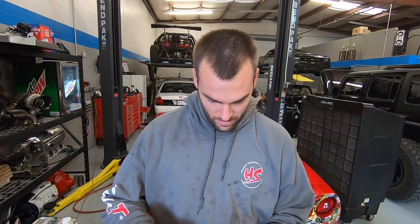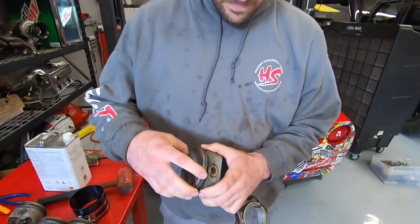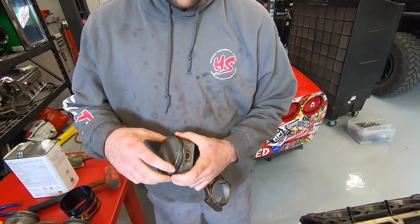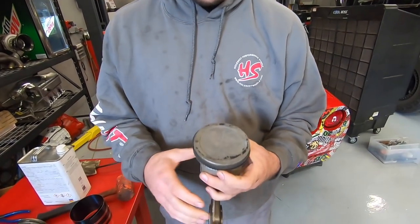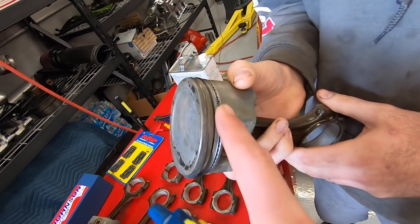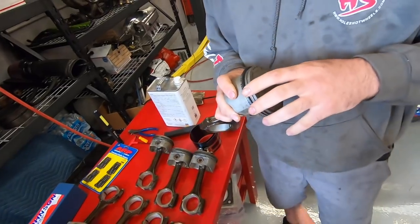Okay. So you got to offset them. Got to make sure you do that. Well, you usually just put them 180 of each other? Yeah, and then not up and down. You want them side and side, or like down here, up here kind of deal. Okay, makes sense. James put the oiling rings in too. And same thing, guys. You don't want the gaps lining up, even though those ones are very small.